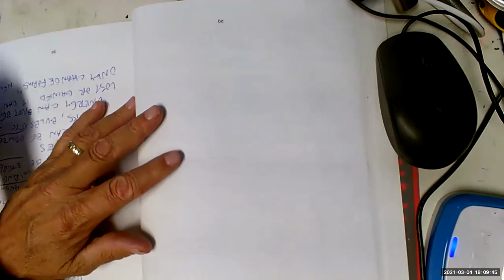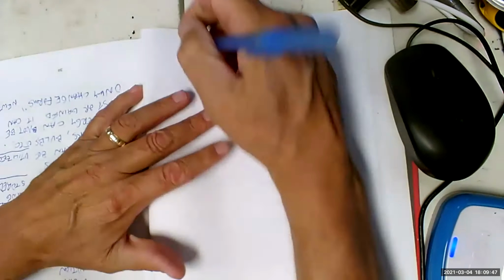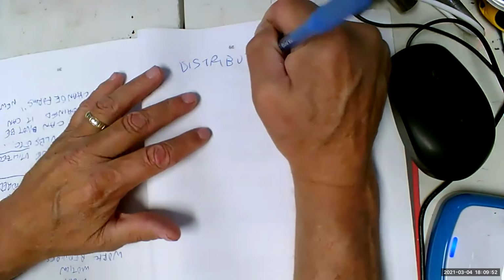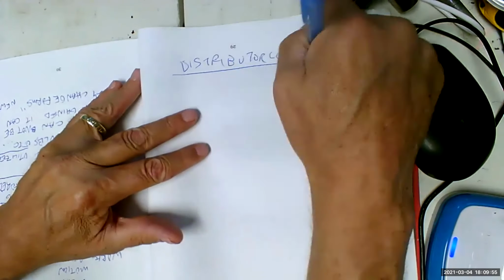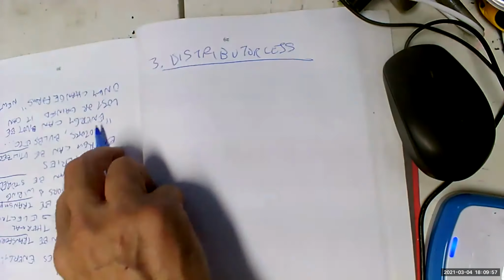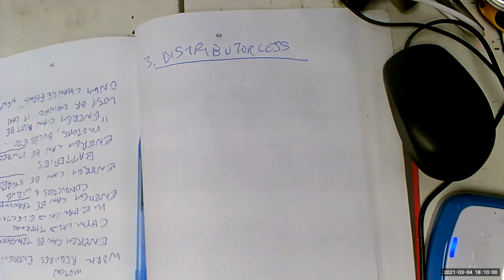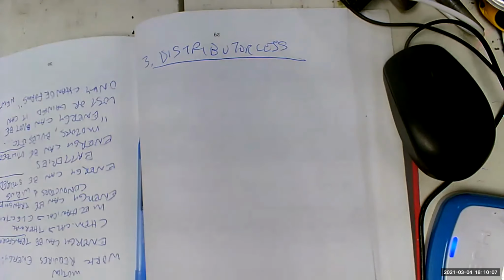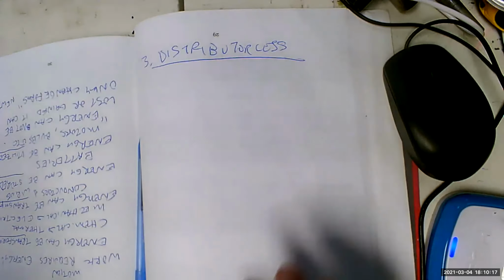There is. Okay, so distributorless ignition. The third ignition system we need to study is called distributorless ignition. And as you can imagine, based on the name, that means that there's no more distributor. Now, why? Because a distributor is a mechanical part. For instance, this is the distributor off of General Motors 74 through probably 90. It's called the HEI distributor. It's really, really big here because the voltages were so high we had to keep them from touching each other.